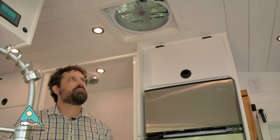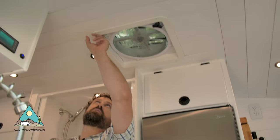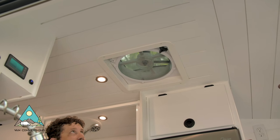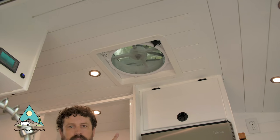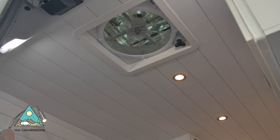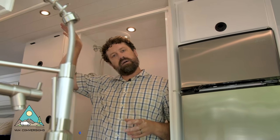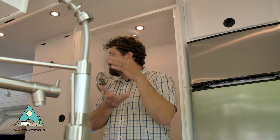The customer wanted more of a stealth look in this van, so we didn't put any windows in it. Instead we put two MaxAir fans — an automatic one up front and a manual one in the back that you can reach and adjust from the bed. You have one pulling air out and one pushing air in, creating a perfect flow of air right down on the bed when you're sleeping — great to cool you down at night.